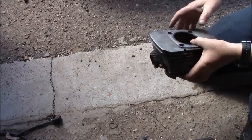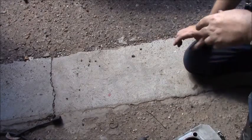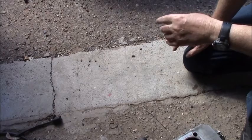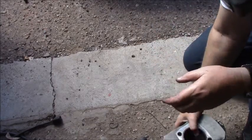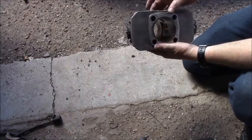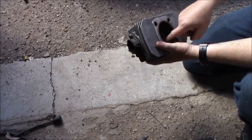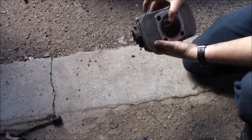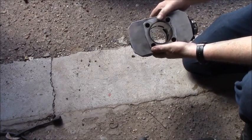A lot of guys don't understand — if you're honing for a re-ring or for a new piston, they think you gotta hone it and hone it like crazy to get all these scratches out. You don't. All it does is give you extra clearance. It's not gonna make a huge difference. There's gonna be enough oil in there to fill those in, and the piston's traveling fast enough that you're really not gonna lose that much compression. It's gonna be fine.